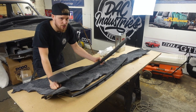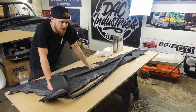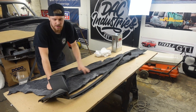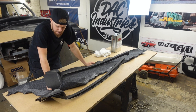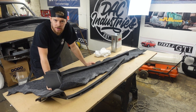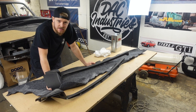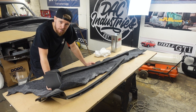There we go, both are now cut and sorted and I found an off-cut carpet that will do one side, and I'll find an off-cut that will do the other side as well. I'm going to wipe them over with some thinners just to make sure there's no grease or anything on them from people putting dash shine and things like that on them. Get a good clean back, a wipe over and a quick sand as well just to key the surface, then clean them again and we'll start spraying and get this carpet stuck on.